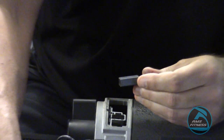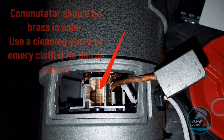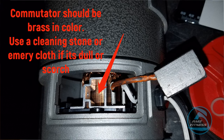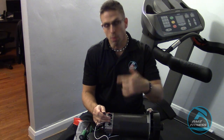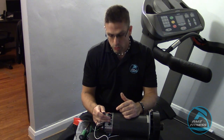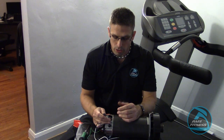The other thing we want to mention — and you'll probably notice in the photograph you're about to see — is called the commutator. That is the brass device in the motor where the motor brush makes contact, giving you the motion in the motor. You want to make sure that's a nice brass color. There are various tools to clean that, but in our case here, we don't have to do that — the motor is in pretty good condition.